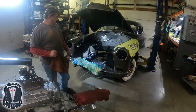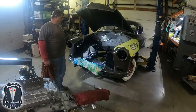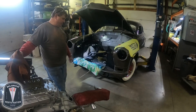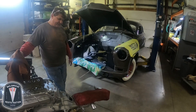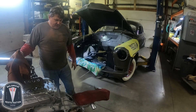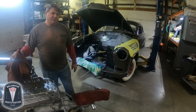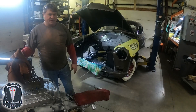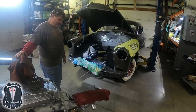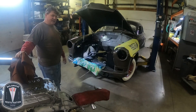This particular vehicle has the floor pan still installed — we did not remove it. In order to do this transmission install without removing the floor pan, it is very tight between the transmission and the belly of the trans. Knowing that, we changed the drain plug in the bottom of the trans to a plug with a female hex fitting, so it's recessed up in the hole and allows us maximum clearance.